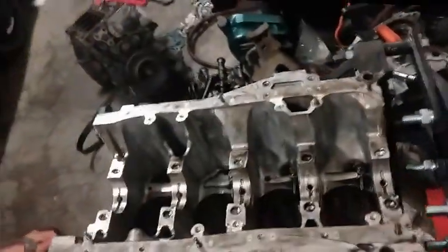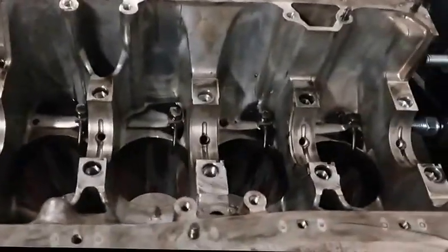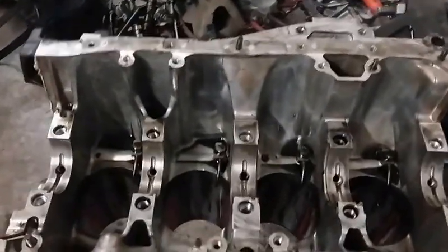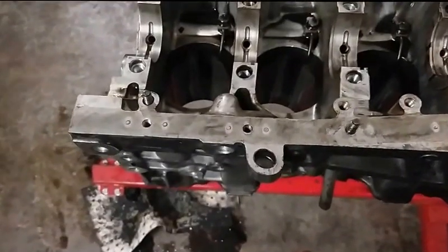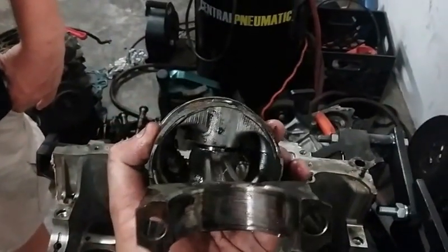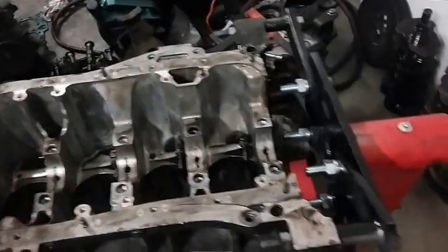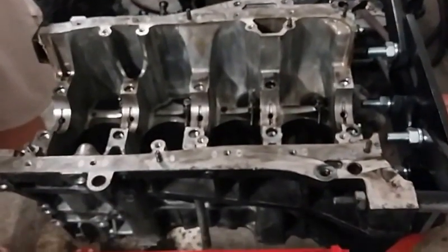On a positive note, the two guys over here got my GSR apart and there's some amazing stuff inside. The guy who built it did some horrible things, but it was actually good that he did, because it blew up really early into his build and the block is still pretty clean inside. Not only is the block clean, but despite the twisted rod, the crankshaft actually came out pretty clean. So far it doesn't have any signs of damage — I'm going to check it out later but I'm pretty confident I'd give it a clean bill of health.